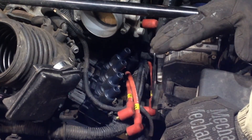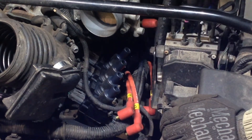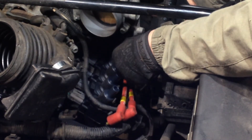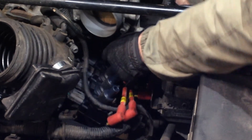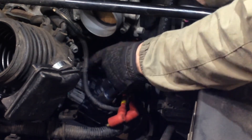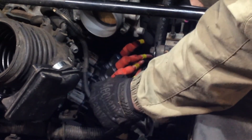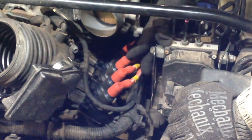Now for the leads. We'll go into more detail on installing leads in a whole other video at a later date. You want to start putting the leads on in reverse order that you took them off, starting with the rear coil — T2, Trailing 2 — which is the trailing coil, trailing plug, rear rotor. Then leading rear rotor, trailing front rotor, and leading front rotor. Make sure all your boots push down on the coils.